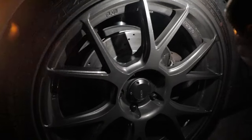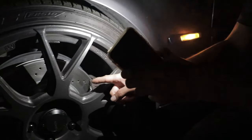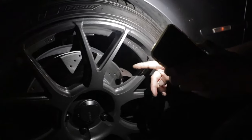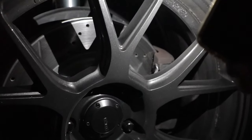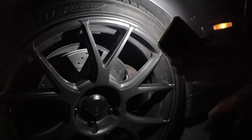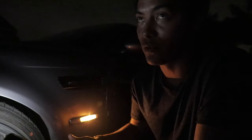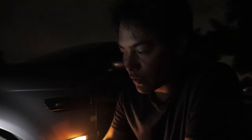After that you should be pretty much good to go. As you can see, you can visibly tell that the rotor is significantly darker and you can see a wear pattern from the pads contacting the rotor — this is pretty much what you want to look for when bedding your brakes. You don't want to see any purple spots or discoloration on the rotors immediately after bedding, because that means you put in too much temperature.